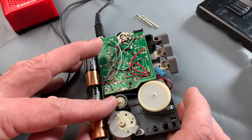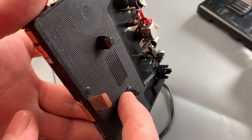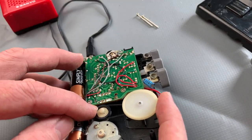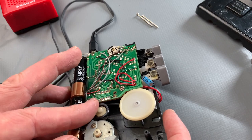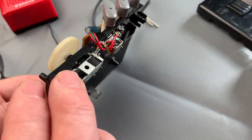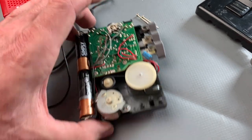There's another belt there that's not turning that pulley — can you see that pulley just there? That should turn, and that's obviously the take-up reel. You've got a moulded reel there and that's the one that moves. I think what's happening is this belt is just not man enough to drive it — it's just slipping and not turning that pulley. So I think all we're going to have to do is remove this belt and replace that one. It's only cheap and cheerful, so we're just going to rip the belts off. I'll get a couple of belts and be back in a second.